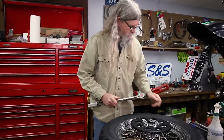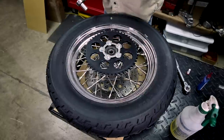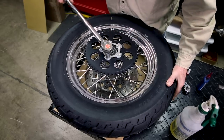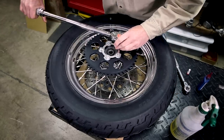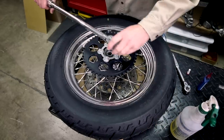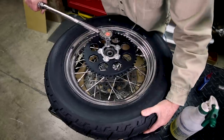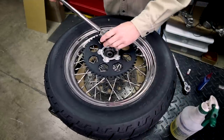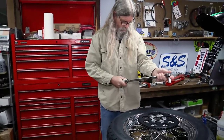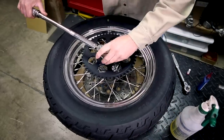And there we have our set, and we're going to go one, two, three, four, five in a cross pattern. Don't use your air impact as a torque wrench. That was 50 — we'll go ahead and crank it up another five just for the heck of it because that is the spec. It is a range. I'm guessing it will already be done — yep, she's already good.